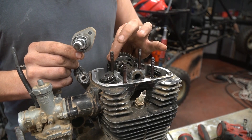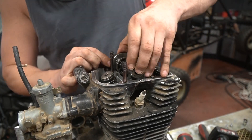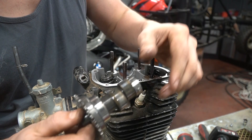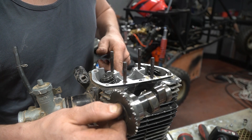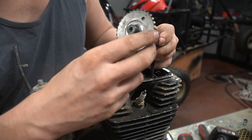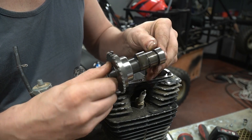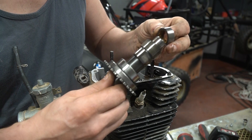This is a cam chain tensioner — it tensions your cam chain. This is the camshaft; these little lobes spinning around are essentially what pushes your valves down to open them. You shouldn't drop your cam chain down the cam chain tunnel, but if you do, it's not the end of the world — you can fish it out. The important thing about the camshaft is that it has to be timed correctly, because if you don't time it correctly, as your piston comes up your valves will go down and your engine will decide it doesn't want to work anymore — with a lot of loud noises. Make sure you keep your cams in good condition, because if they wear out it causes bad things to happen to your valve timing and you'll lose a lot of engine performance. So look after your cams and their bearings.